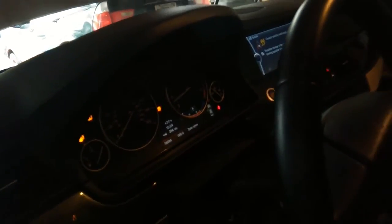That came up with a chassis stability malfunction. Yeah man, it refers to the chassis stability because the ICM is monitoring the setting of the whole thing. The ABS unit works with the signal sent from the steering position, right? And all of that. So therefore the ICM really makes that come up. Really and truly this is not set. It needs to be set properly. We have to follow the procedure again.